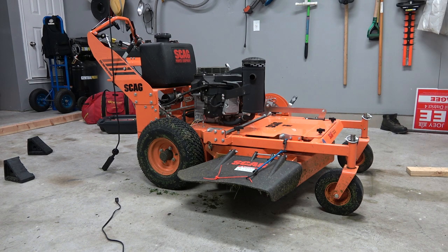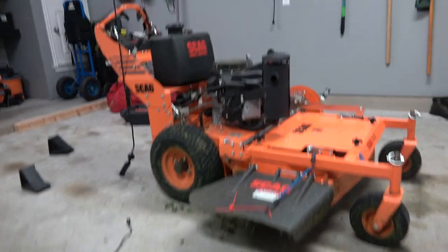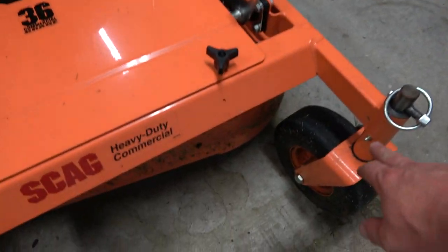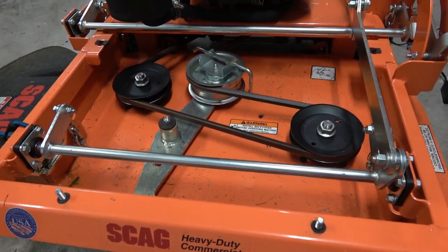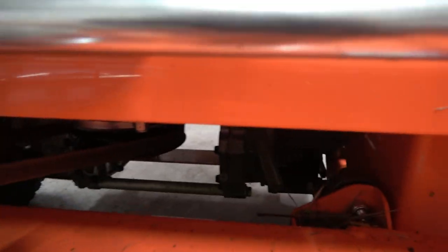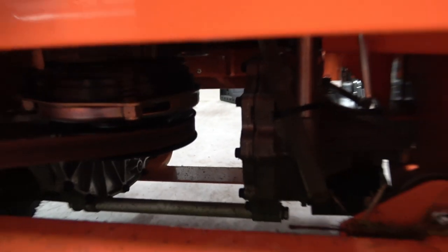I hope you found this video useful. If you have any questions, please post them in the comment section below. I love the mower — if I had to do it again, I would absolutely purchase one again. Until the 36-inch standers get larger drive tires, this walk-behind is both good for me physically and great for the turf because it's lightweight. The cost, the value, the construction, the adjustability on the deck — I love it. One last thing: the only grease points on this mower are your front casters. There are literally no other grease points — none of the pulleys, the belt tensioners, nothing else is greasable outside of those casters. Thanks for watching — see you on the next one.